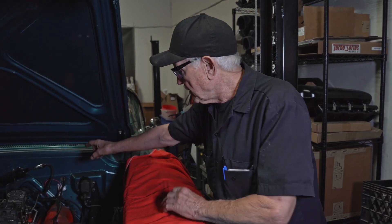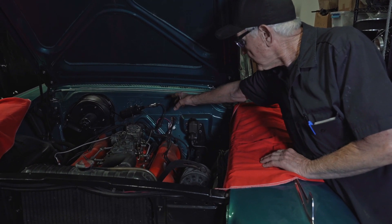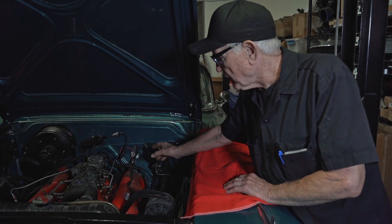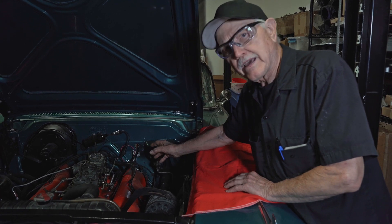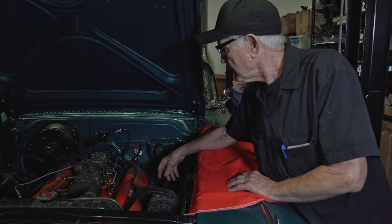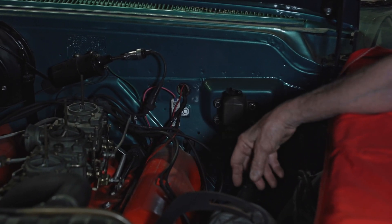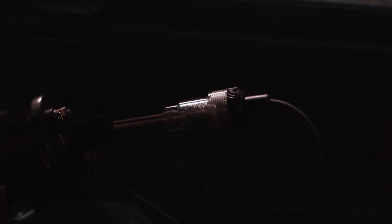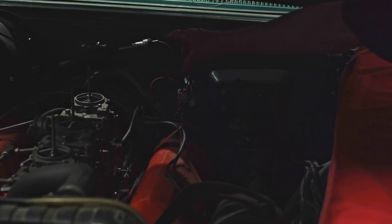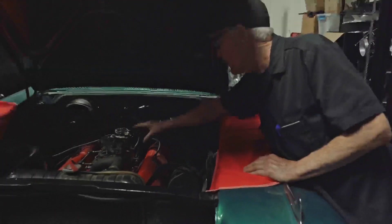I've got a little device into the coil that shows the intensity of the spark. This is a points ignition system — the old school. Back in the day the gasoline was different, it might have lit off quicker, but today's gasoline she just won't start. You can barely see any spark coming out of the coil and there's none at the spark plug — it's losing it all through the wire.